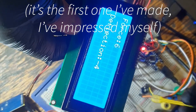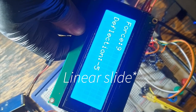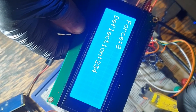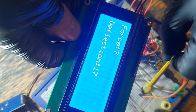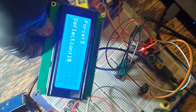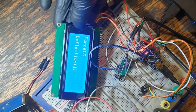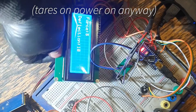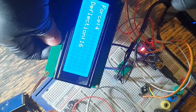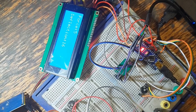I've also added in the deflection. I've got a linear potentiometer coming tomorrow, but that should just replace this rotary one here and attach somewhere — I haven't quite figured out where, but that will show me the deflection versus the force. It resets the potentiometer position reading every time you reboot it, so I'll just have to get it set up, reboot it, and then it'll start from zero. The force is just zero when there's no force, so that doesn't need zeroing really. The numbers are arbitrary — they're not calibrated — but it's a comparison, I don't need to know the actual figures, I just need to compare them.